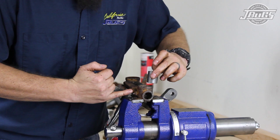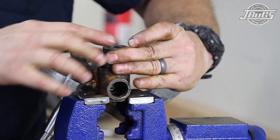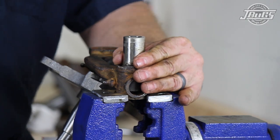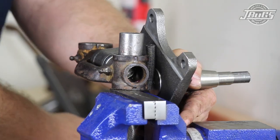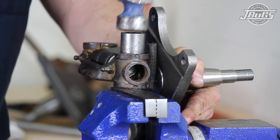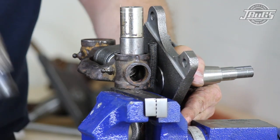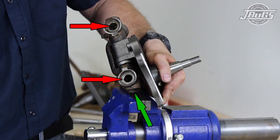The assembly is removed from the vise and clamped back in on its side so the link pin bushings can be tapped into place. With drop spindles, installing the lower bushing is simple as there is plenty of clearance for an extension and socket. Make sure the grease hole in the bushing is pointing towards the king pin to ensure grease can enter the bushing. We start with a similar sized socket and tap the new greased bushing almost flush with the carrier, then switch to a slightly larger socket to ensure the bushing is installed flush and tap it all the way in. There is less clearance for the top bushing as the drop spindle sits higher to lower the car, so the spindle is braced by hand against the bench vise while carefully tapping the greased bushing into place as squarely as possible — again making sure the grease hole points towards the king pin. The reamer can be used to make sure the bushings are not deformed and will accept the link pins smoothly, as both king pins and link pins are reamed to the same size.